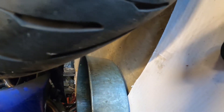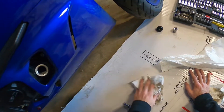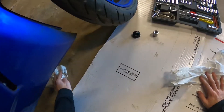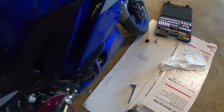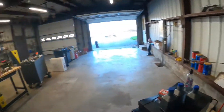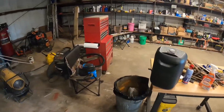As a beginner bike, most people haven't changed the oil. I've changed the oil a lot on a lot of different things. You want to wipe up anything on the ground so you can tell if it's leaking oil — which if you did it right, it's not going to. But sometimes there's a crush washer on the drain bolt and sometimes they just don't like to work as well as they used to.